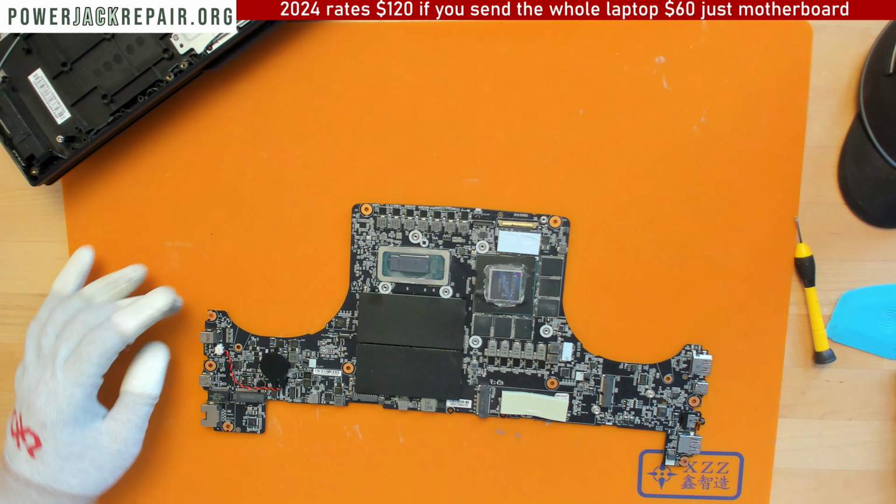Ah, right there, you see already, right there. That's not supposed to look like that. This solder point basically became desoldered, all right? Because of 12 amps going through this pin, this is a positive pin right here. This is the central pin going here. Right, this is the positive, and the negatives are right here on those sides, 1 and 2. But this is a positive end, and because of this desoldering here, the inside of the connector basically got messed up. So that's your problem here.